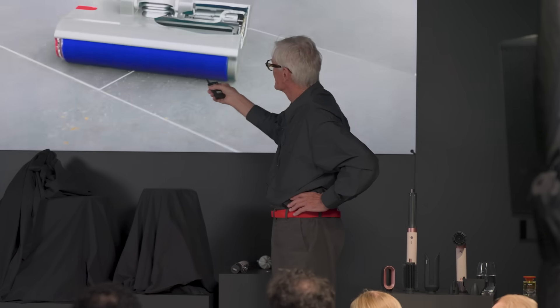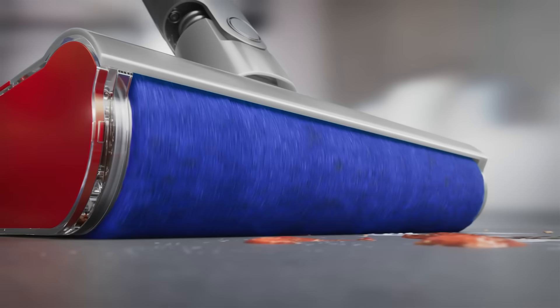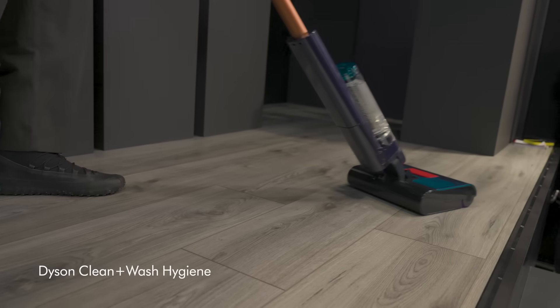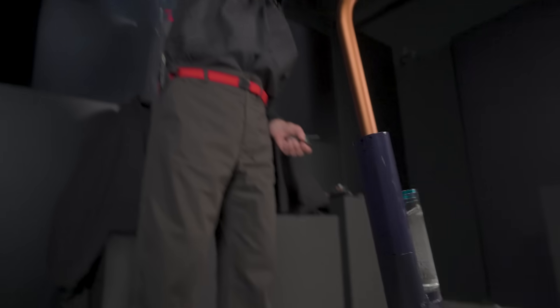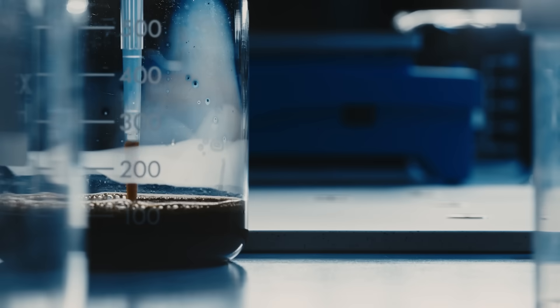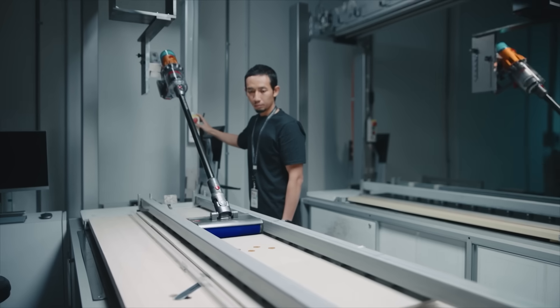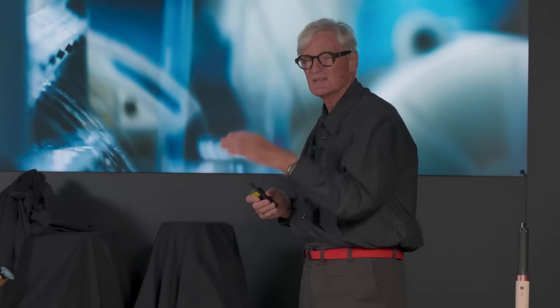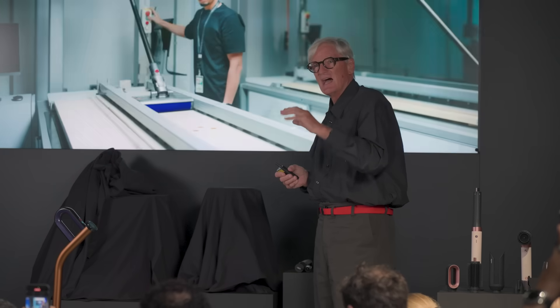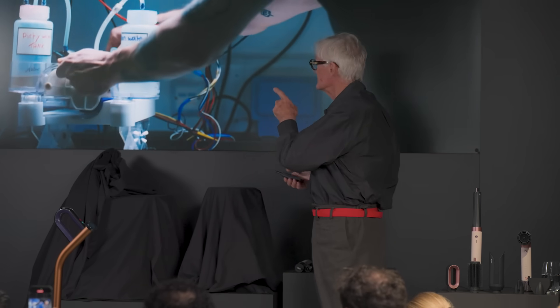It can come with a submarine head where you can wash the floor and keep all the dirt in the cleaner head. And I can reveal another new machine to clean floors with. One of the things about mopping floors is you spread the dirt. We've done a lot of tests to stop that. One of the important things is that every rotation of the brush, you must add fresh water and squeeze off the dirty water — only putting clean water and a clean roller onto the floor, so you don't smear.